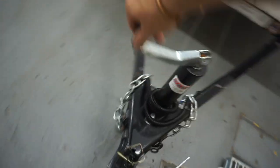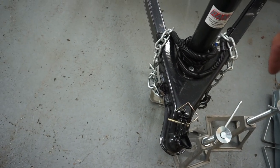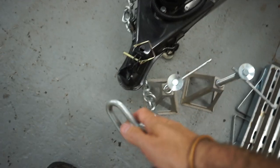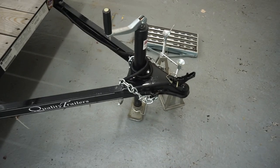Let's get to the front end. Trailers will all come with one of these cranks so you can raise or lower the hitching point to where you need to connect it on your tow vehicle. This is a two-inch receiver, so you need a two-inch ball to tow this. It comes with chain connectors — all very standard. These connect to the back of your tow vehicle. Hook both chains up and give them a little twist if they're too loose, because you don't want them dragging on the ground — they'll throw sparks.